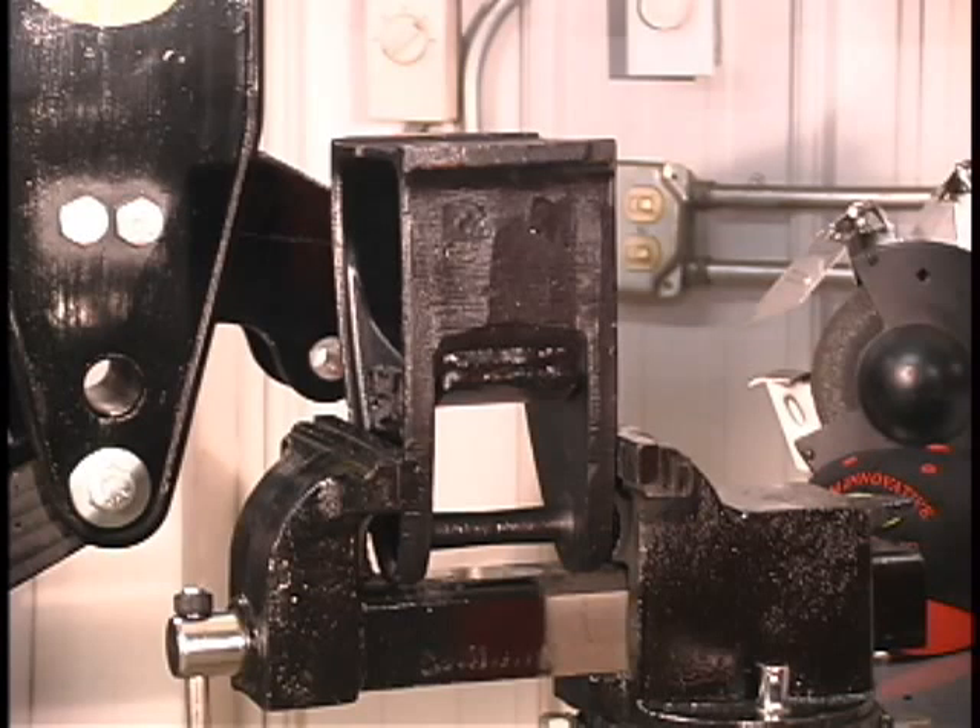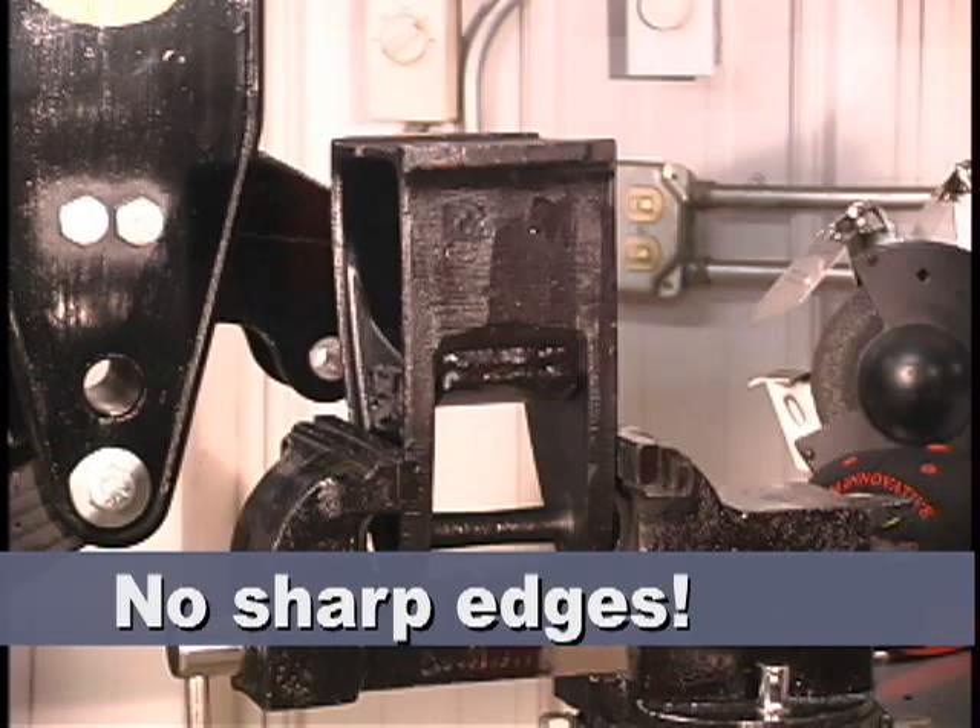It's recommended that existing wear pads, protection products, old existing welds, and fasteners be removed before installation of the EWP wear pads. If the wear pad is installed over a sharp object, it may cut into the wear pad and cause damage. If you install the wear pads over an old style steel wear pad, there must be no sharp edges.